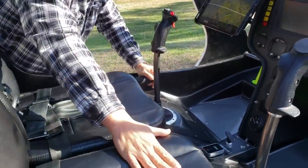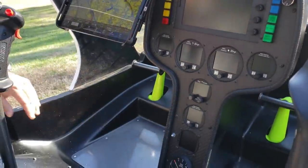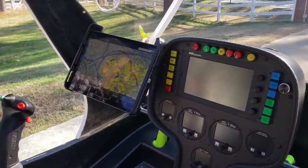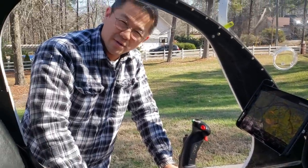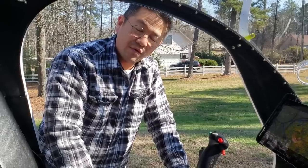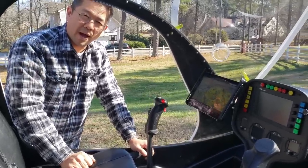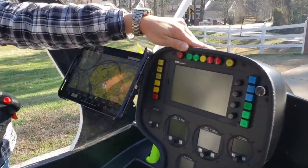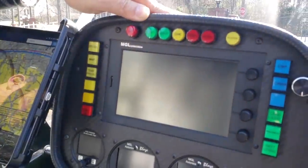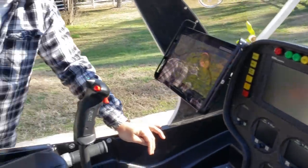These are the two seats — the pilot sits here and the passenger sits here. You've got your console here with all your instruments, and I have ForeFlight running for traffic monitoring. This ship weighs about 1,000 pounds empty without fuel. Max gross weight is 1,500 without the turbo and 1,630 with the turbo — mine is the turbo so I have a little more capacity. The Talon comes standard with glass, which is quite amazing for an experimental craft. Another thing that's unprecedented is the FADEC system — it has dual redundant engine control. Part of every startup, you cycle the engine control to test each one individually.